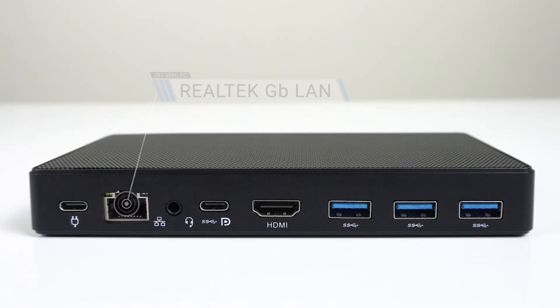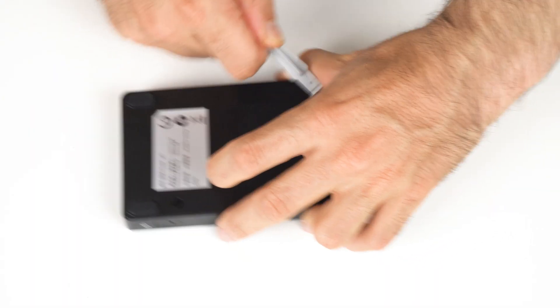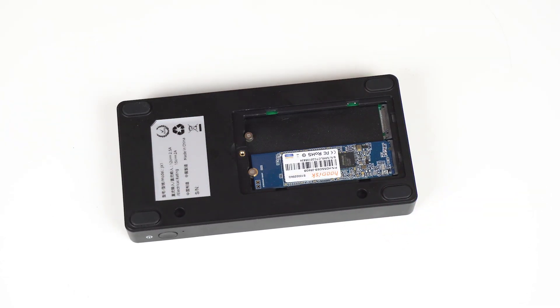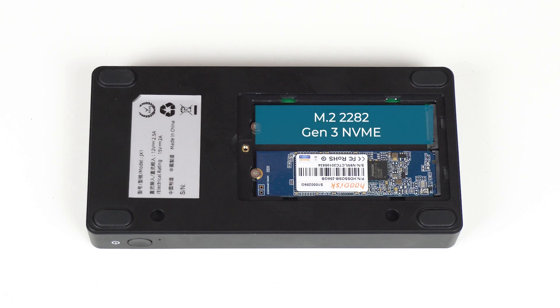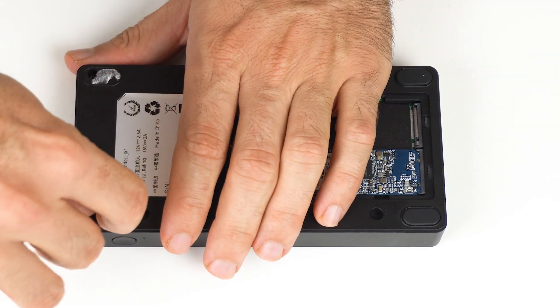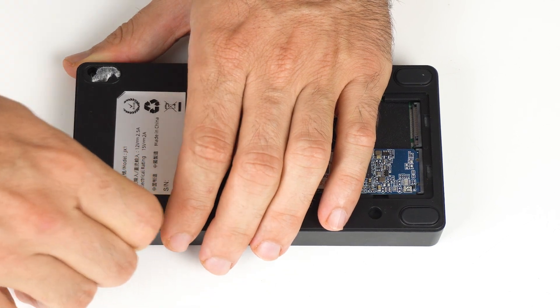All the ports are housed on the rear. Let's have a look inside. There's one screw to remove and then off comes the lid. There's an extra M.2 slot — the extra M.2 doesn't support SATA, but it does support Gen3 NVMe. They're definitely underselling this mini PC by not mentioning it. And of course, there's the 256GB HuDisc SATA M.2 included with this one, which holds the OS.